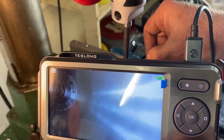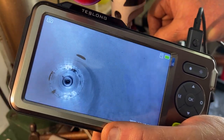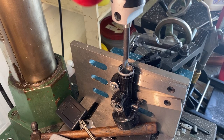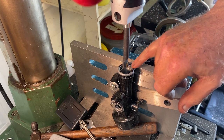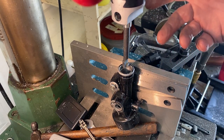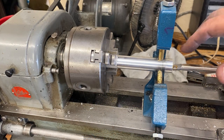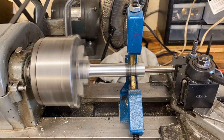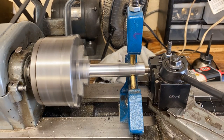Good surface finish — I can see a nice reflection on it. The size doesn't ultimately matter since we're going to size the piece that'll be the new sleeve to whatever I cut the bore to. I didn't want to go all the way to the bottom so I'd lose the witness mark — but I can see how deep this needs to go and I know I'm all the way to the floor of that bore. The sleeve ID has to be at 0.625 (5/8) and the tubing was just a little smaller than that, so I'm taking skim cuts to get it out to that dimension.